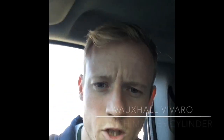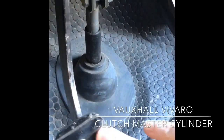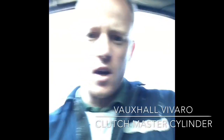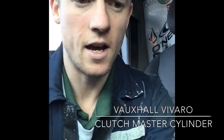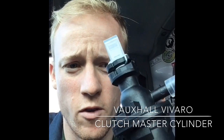Hi guys, I'm going to show you, hopefully, how to change one of these clutch master cylinders for a Vauxhall Vivaro van. The issue that I'm getting is, I don't know if you can hear this noise, but every time I push the clutch down, I get this clunking sound. So, I did a little bit of research online, and I spoke to a couple of car garages, and they all suggest changing this master cylinder first of all.